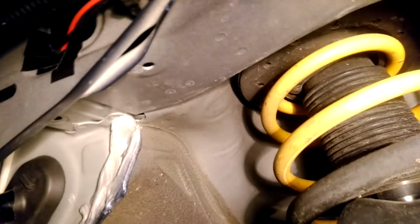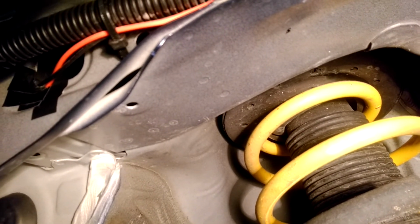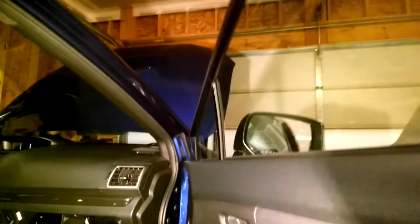Again, this is going to be hard to see, but I came back down through the top there, and I found a little rubber grommet here in the firewall. I poked a little hole through there with a little shish kebab skewer I got right here. Made a nice little hole, and then I just stuffed the wires through. And what I ended up with is, on the inside of my car, cherry as can be, baby. Look at this. Couldn't have paid somebody to do it any better. I got all my wiring that I need to run to the back of the car, neatly bundled here.